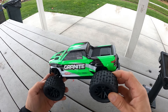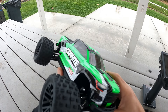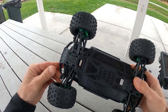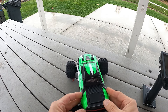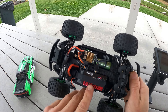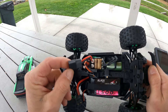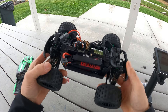Ready to bolt it on — we made it outside, got it built. This is our drive review for the Arrma Granite Grom original, heavily modded. It's raining outside today. Under the hood we're using a CNHL 1500mAh 100C 3S battery, which already comes with an XT60. We went ahead and wired an XT60 straight to the Castle ESC.